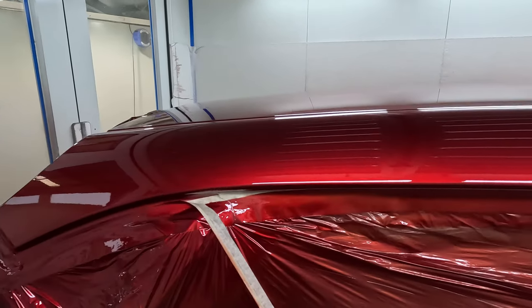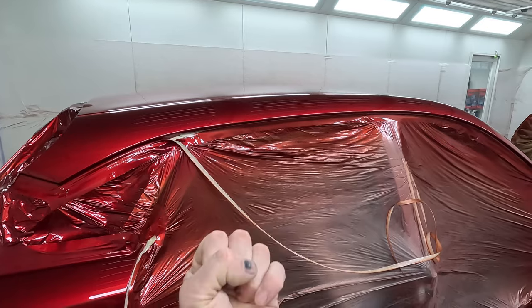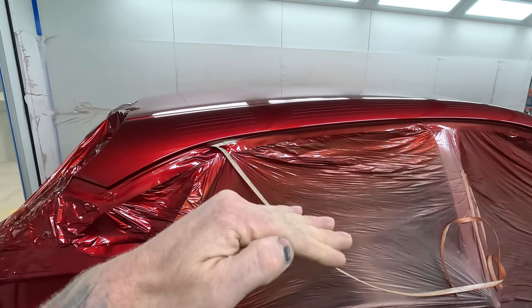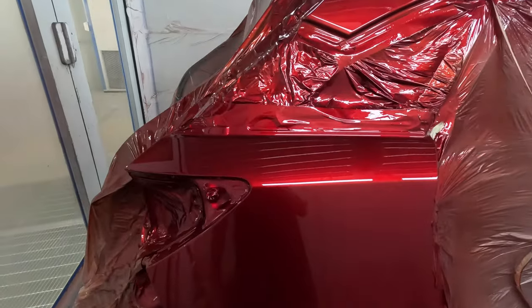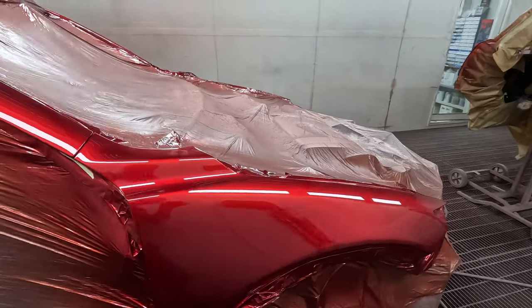And partly because of that, because you're putting those extra coats of clear, those two coats of clear, that could be the coat that sort of dies back with the waterborne, and because there's four coats of clear on there, you actually get a better gloss retention, as long as you do bake properly in between coats.